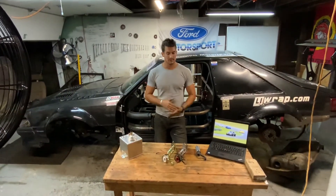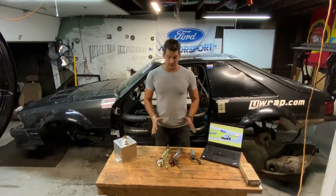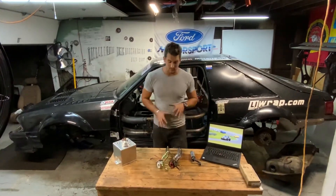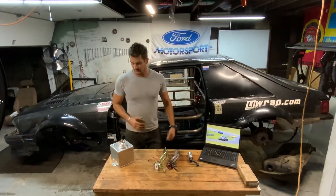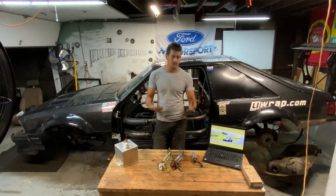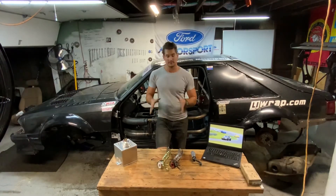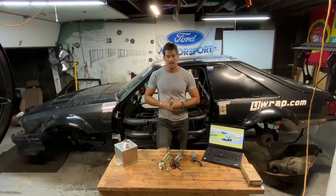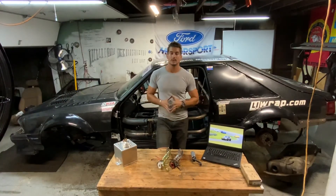One part of the solution is moving away from your stock hanger. I'm pretty sure with a new gas tank and this performance hanger that would probably solve most of my fuel issues, but going another step for insurance, we're moving up to a surge tank with a secondary pump. I did order a new stock gas tank because the baffles were broken in it, which I just found out recently — got a stock tank for $125 from Late Model Resto, should be here shortly.